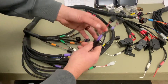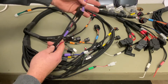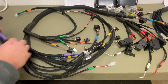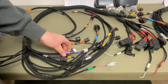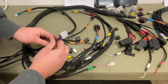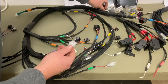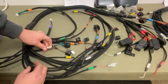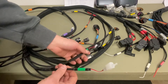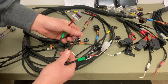You have your injector plugs, these are set up for a gen two Busa or a GSXR. These plugs can be cut off and adapted to a gen one Busa peak and hold. If your injectors are low impedance you need a peak and hold box; if not, they are high impedance and you can put a peak and hold jumper in. You have an extra outputs connector, crank VR, a crank hall sensor for a universal bike, and also an engine ground.